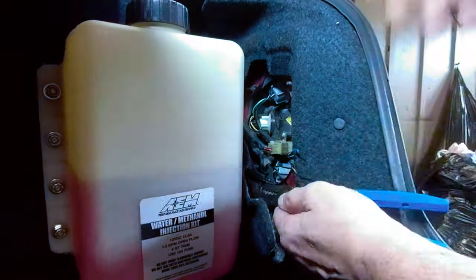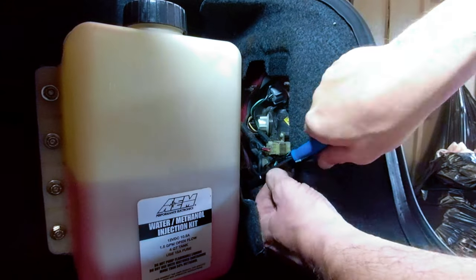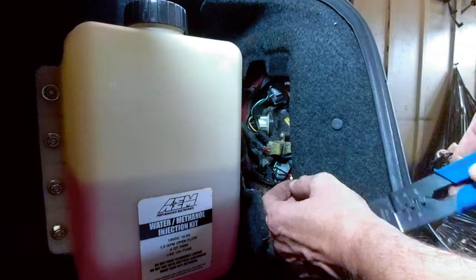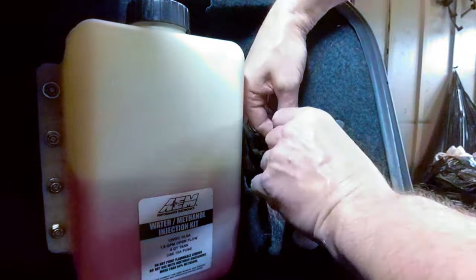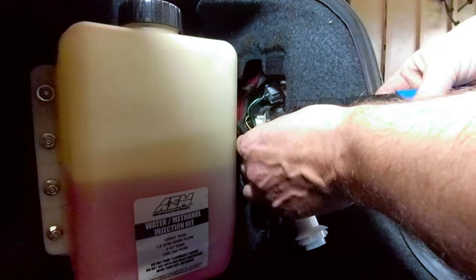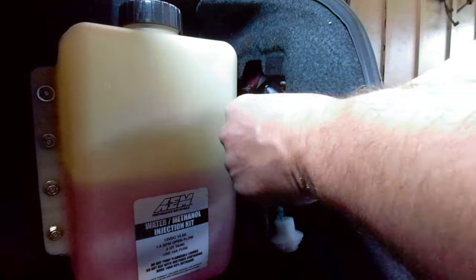I'm not doing anything terribly fancy with the wiring, nothing you haven't seen me do before. I just cut off the bad connector, strip the leads, twist them together, and use copper crimp connectors to attach them. Next comes the waterproof heat shrink that actually does have a small amount of low melt solder in it, which I really don't need, but I'd rather it be easy to do and waterproof too. Yeah, look, don't judge me.